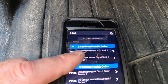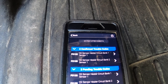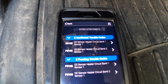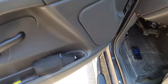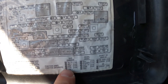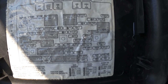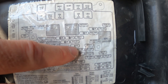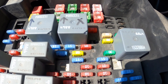I got thinking about it — because it was the circuit code, I was wondering if that wire that had touched the drive shaft may have shorted out and popped a fuse. What I found out is that these oxygen sensors actually have heaters in them that come on before the exhaust gets hot enough to make them work. So I went up to the power distribution fuse box under the hood, popped the cover off, looked at the diagram, and right there — numbers three and four are labeled O2A and O2B — the oxygen sensor fuses.